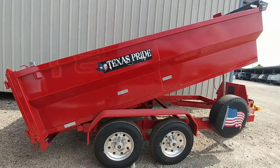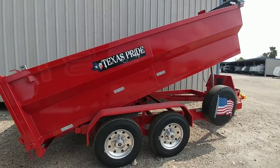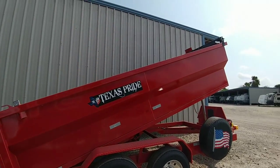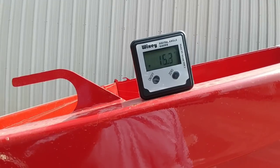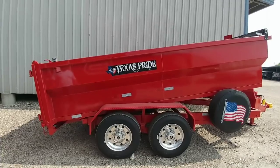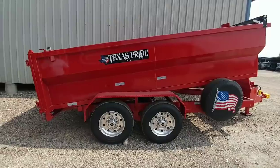We are at a 20-degree angle right here, which is about optimal for trying to slide something up the back. But in reality, I'm guessing it's probably going to be more like 10 degrees if you're going to be loading something like that thing we found on the beach. We don't want this thing straight up - we want a nice gentle slope so we have the ability to pull it on without putting too much pressure or strain on the winch. Let's drop this to 10 degrees and see what it looks like. So 9.9 - that's pretty close to 10 degrees. That is a nice shallow slope that would give us exactly the angle we would need to load something in the back of the trailer.